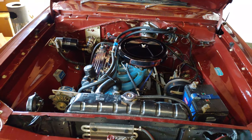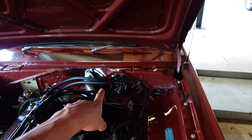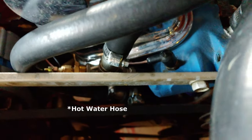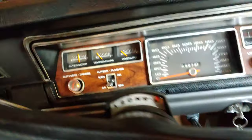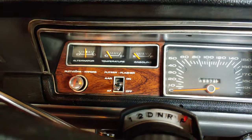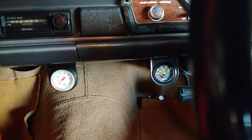Before we get to that, I just wanted to show you some work I've done on the Regal. I finally fixed the heater in this car as well — I replaced the hoses, but down here at the bottom hose I made a tee piece so that I can add another temp sender, because the stock gauges are just stripes, as you can see — you have no clue what the temperature actually is.